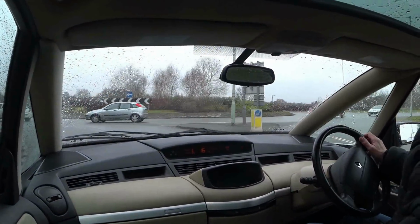And my guess is that they're probably better than anyone at dealing with this car. So I've booked it in, and we're going to drive it up there, leave it with them, and when they get a chance, they're going to try and work on it. Now, hopefully, there isn't much they need to do to it, because I'm guessing that the fault's been repaired, but the car hasn't been able to get booted back into working condition. But we'll see on that one. The other possibility is that the accumulator has failed again, because it ran without any fluid, or that the pressure pump has failed, because that also ran without oil in it, from what we understand. So that's an ongoing thing that we'll find out in the next week or so.